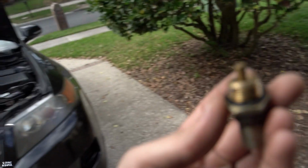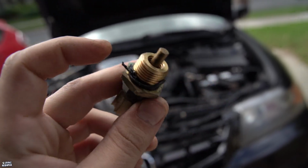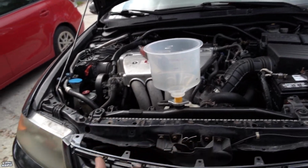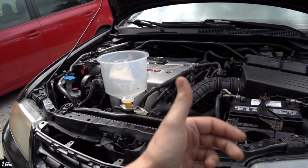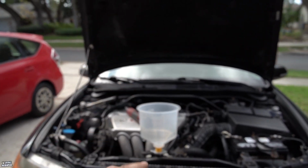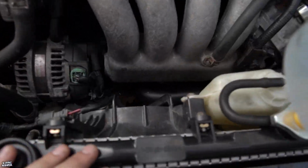Alright guys, as you can tell, we're at that point. Everything is on. I swapped out the O-ring for the coolant temp sensor. This is the old one, which was beat up like crazy. I got one from Advance Auto. It wasn't the exact size, and Honda didn't have one, so I couldn't get OEM. Hopefully it should work regardless. And I put a little bit of Mega Gray Honda Bond on that back screw, and it should be pretty tight, and everything is on.